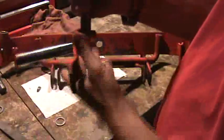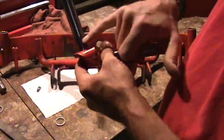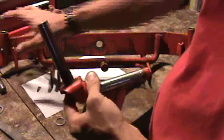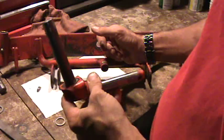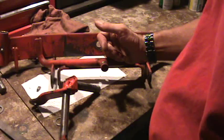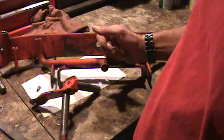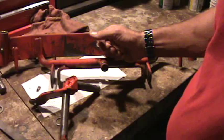In your bushings that your spindle turns on, you'll need to inspect your spindles and make sure you don't have any excessive wear. If you do, the bushings are only four bucks apiece to replace — it's a worthwhile investment to prolong the life of your tractor. If anybody has any questions, please feel free to ask. My next tutorial is going to be on removing and installing points on these older Briggs and Stratton engines — I've had a few requests, so look for that in the coming days. Thanks, guys. See ya.